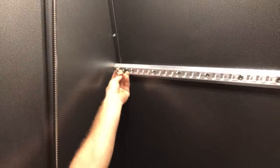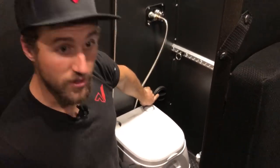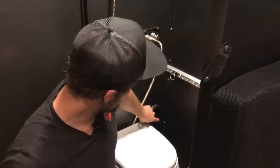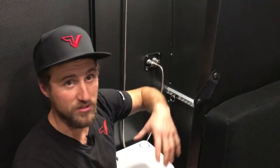This client is a really big skier, so the idea was he can throw his skis and boots in here and crank the heater. Down here is the vent for the heater — you can control it so you don't have to put hot air into the shower stall, or you can open it up and get the skis and boots to dry out. Everything drips dry and drains right into the gray water tank mounted underneath the vehicle. We designed a base plate with slats — it's a stainless steel basin with a durable platform to stand on that you can pull out, rinse off, and throw back in.